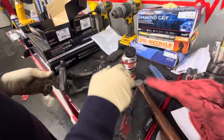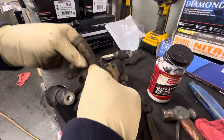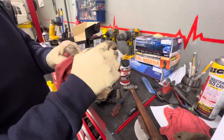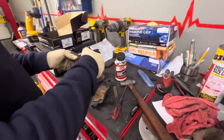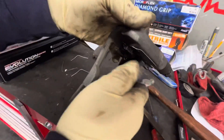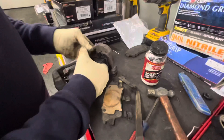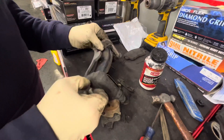The inside pad — here's the pad that went over here with the clips. Take these off, get the new brakes, and slide them in place. They can be kind of difficult, so put the first one in on this side first and then tap the other in a little. Get the hands as clean as possible; scuff the pads with sandpaper to get paw prints off. This one goes on the inside. They're tough to get in — wedge them in at an angle and they're tight going down into place. I kind of made that look easy but it's a bit of a pain.